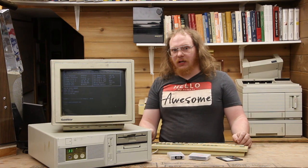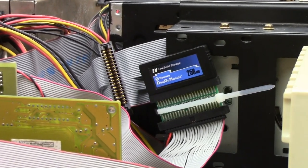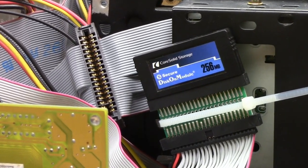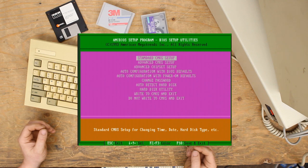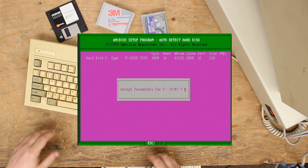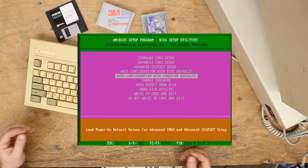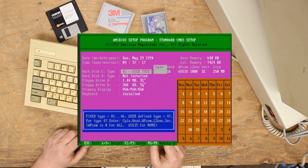Yes, this video is from 2021. As a result, instead of putting a mechanical hard drive in there, I've put in a disk-on-module — one of these little buddies right here. It's 256 megabytes, so it's underneath most major BIOS limitations. They are auto-detected and do CHS translation with all standard BIOSes, so you don't require DDOs or special software to get them running. They're small, flash-based, run completely silent, and use pretty much no power.